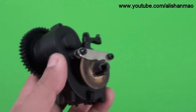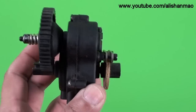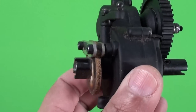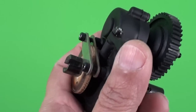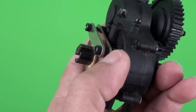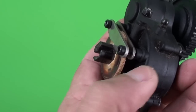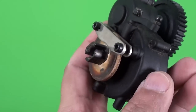Let me pick up one of the transmissions I have already taken out. Here it is — it's the same design. The brake disc is black because we've used it before. We'll open it and I can show you how to adjust the brakes. This is the brake arm — when it pushes this way it will brake, pushing the disc pads so they catch the disc. When the disc is not moving, of course your transmission is not moving and your car is braking.